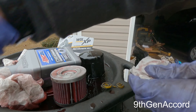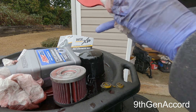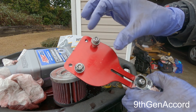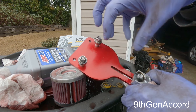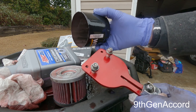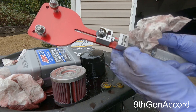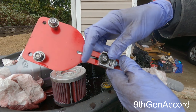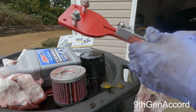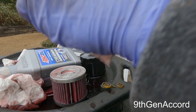I'll have a description link if you ever want to cut open your oil filters or transmission filters — any metallic canister filter you can cut open with this tool. These two studs have bearings on them and you can move them up if you have a really big diesel oil filter, which are a lot wider, so it is adjustable over a pretty wide range. The cutting wheel is replaceable, and it's a really high quality unit. There's nothing like being able to see what's going on inside the filter because it gives you a good snapshot of what's happening inside the component.